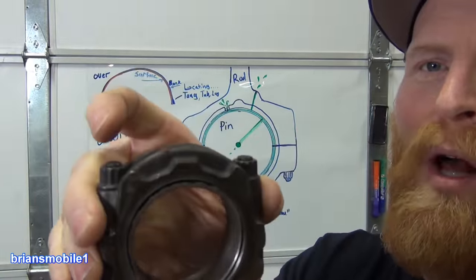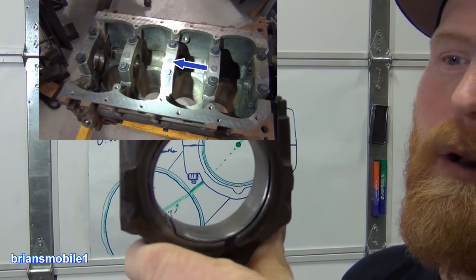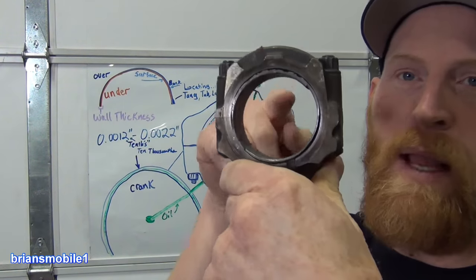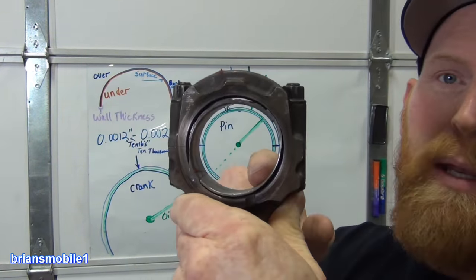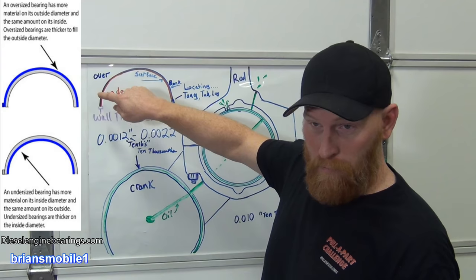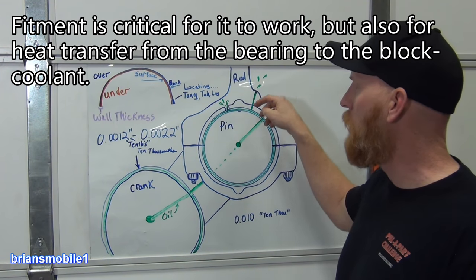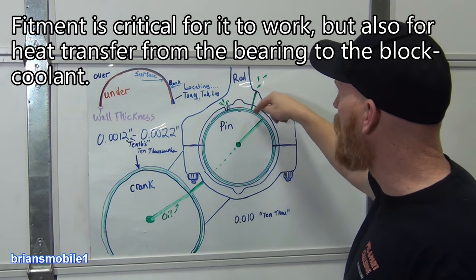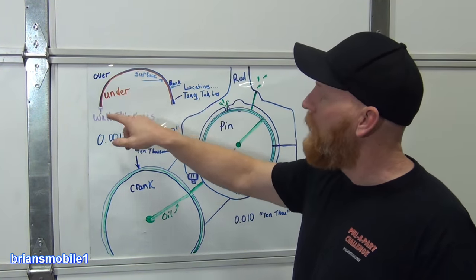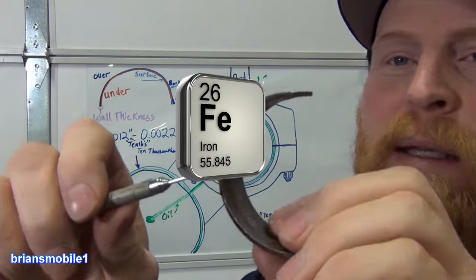Pretend these are main bearings and the block's upside down, these are the caps. If you have wear there you have to line bore all of these together, and then you have to get oversized bearings — because when you cut out material and line bore all the caps and the bottom of the engine block, now you have oversized. Always think of it in terms of this position like a rainbow: you're adding more material over it, or more material under it, because we cut out 30 thousandths on the crank pin — the rod journal — whichever you want to call it, whether you're referring to the surface or this part of the crank.